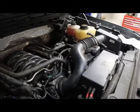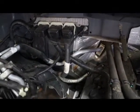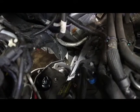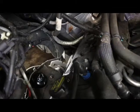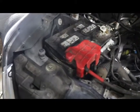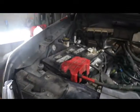And inside here, make sure that you have your housing bolts, the top of your strut housing bolts or nuts tightened up. You probably don't want to hammer on them too hard. I don't know what the specifications are for torque, I'm sorry. I'm sure it's all available somewhere out on the internet.